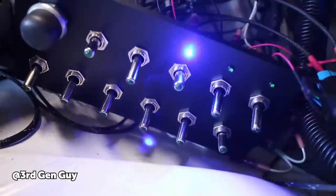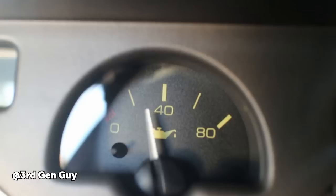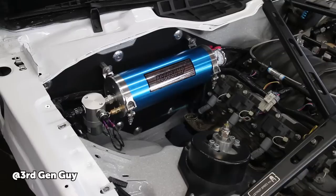The other element worth highlighting is the use of the AccuSump as a pre-oiler — particularly if you have a car that only gets driven a handful of times a year. Getting good oil flow through all the bearings and rotating assembly prior to startup can reduce wear. The AccuSump works very well for this — it can be a primary or secondary function. It can hold pressure for a long time, so whether you have an electric or manual valve, you simply open the valve before startup, it pumps oil in and builds pressure, protecting against dry-start damage. And as soon as the engine is running, the AccuSump will refill.